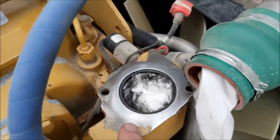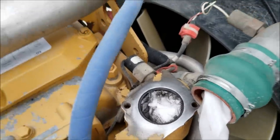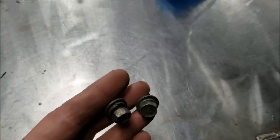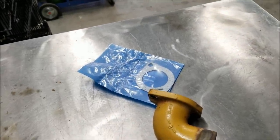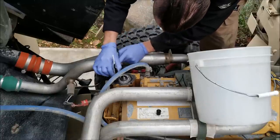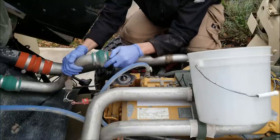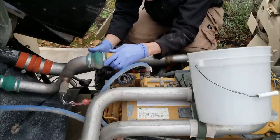Now that that's done, I'm going to deal with the gasket. I'd like to find some new bolts instead of the ones that were there. I dug through the Subaru parts bin and found some nice hardware with lock washers and standard washers. I'm going to put a thin layer of RTV on both sides of the gasket, get that reassembled, get some coolant in it, and then test it out.